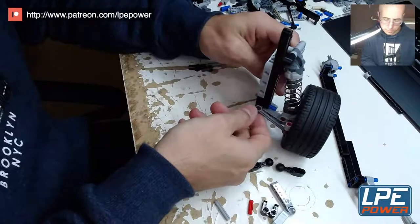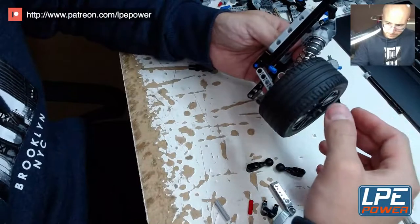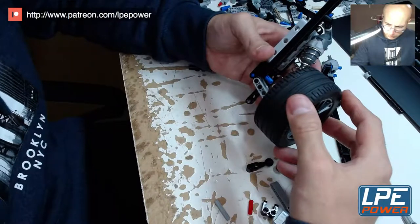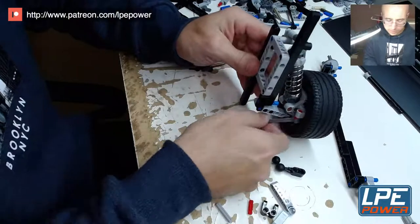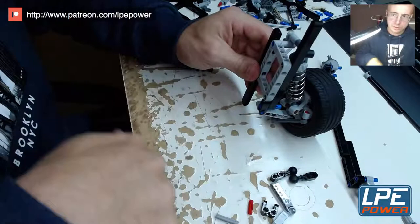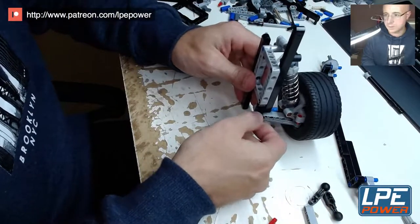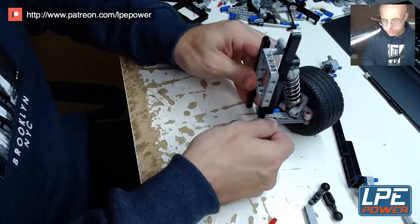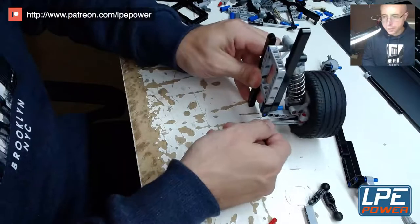My preferred option, of course, would be if the steering link would be one step further in the wheel. Does Ackermann mean the wheel turns one way more? Yeah, that's the thing. The wheel on the inside needs to turn a tiny bit more than the outside wheel, because the inner wheel describes a smaller circle than the outside wheel. This isn't super important with what we're doing, but it's kind of nice to have. The Sierra is kind of the car that maybe should have it. But it's probably gonna have it, no matter what.